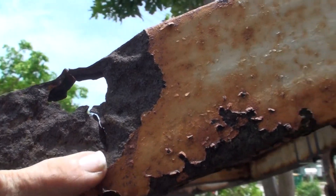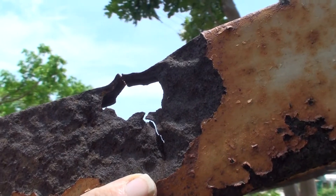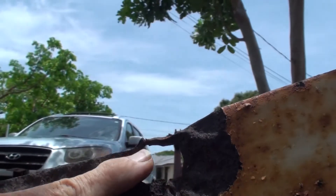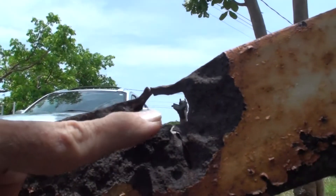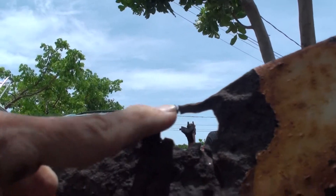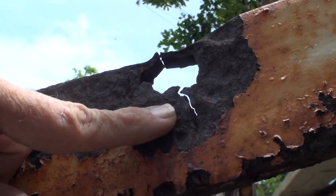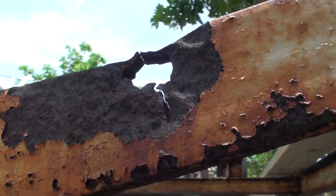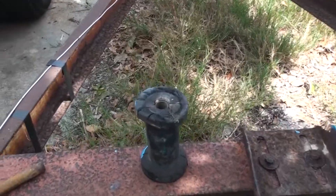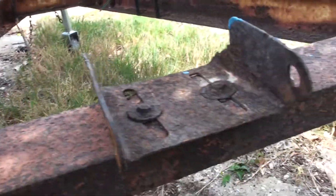My trailer is made out of rust and there is a little bit of steel underneath the rust, and that steel is cracked here where this hole is rusted through. This top part is the most disturbing because it cracked while I trailered the boat home. The way it's bent up there tells me that beam had been flexing — it was stressed while the boat was being trailered.